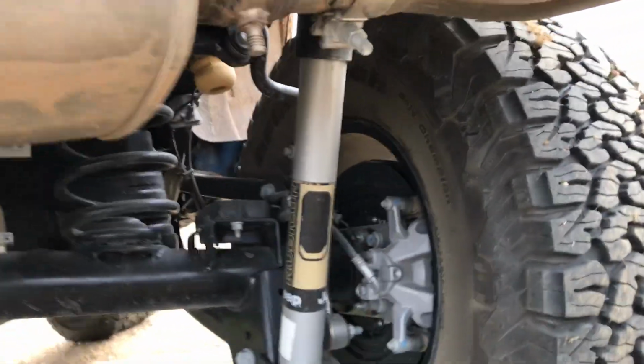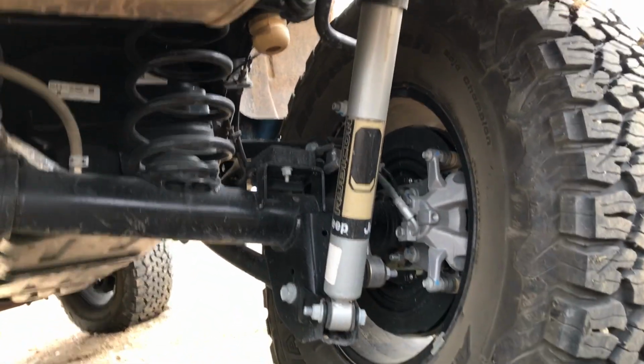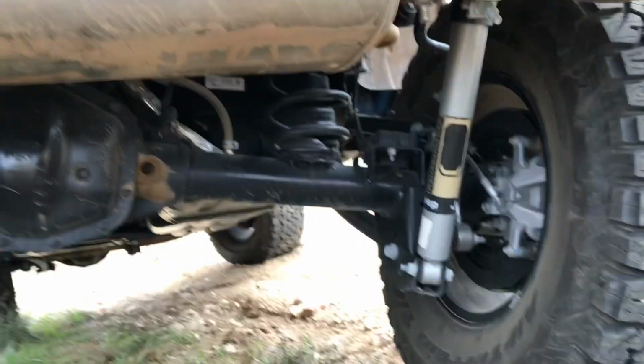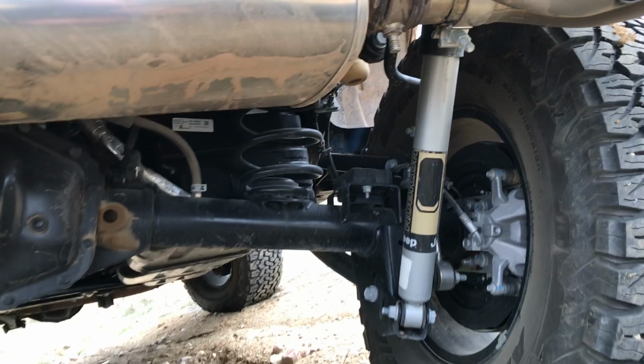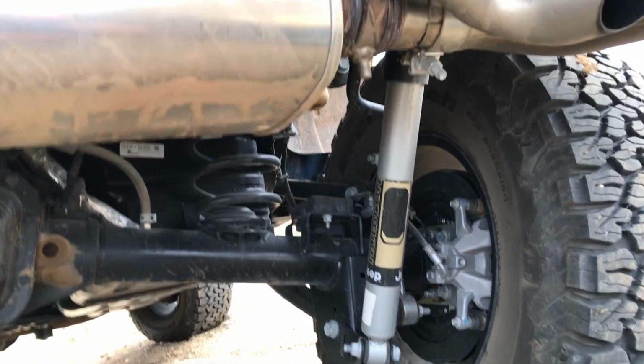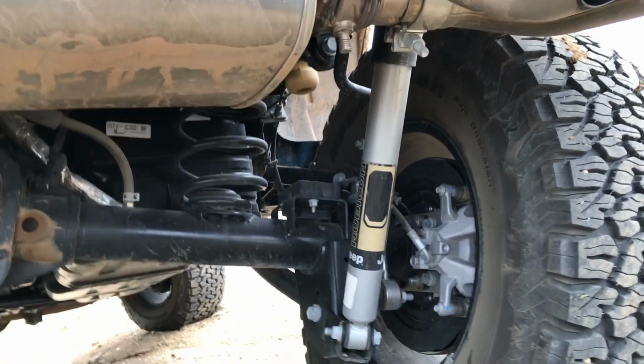Onto the rear suspension, it's a little more complicated because we'd be between shock sizes, so there's no need to really lift the back. So I'd like to see the aftermarket find a way to optimize the shock lengths back here so they're not topping out and of course not bottoming out at the same time. So some optimization in rear shocks would be great, and also upgrading to some large diameter compression adjustable or just overall adjustable external bypass shocks would be great back here.